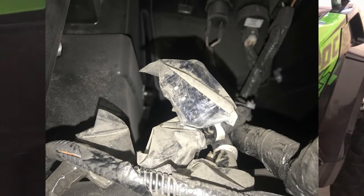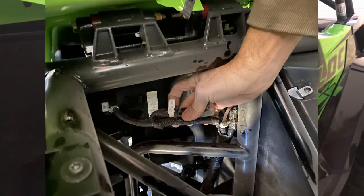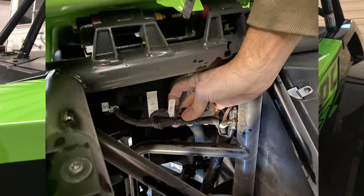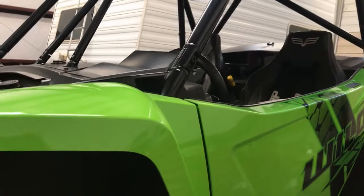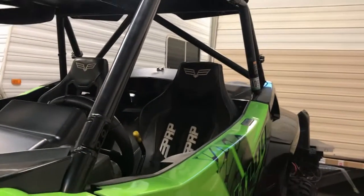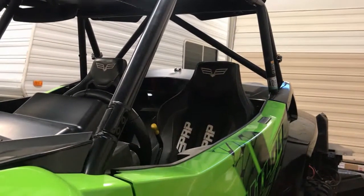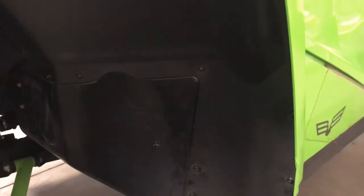So just like the B circuits, you plug the switch in, put it in the knockout right underneath the light switch on the driver's side. When you do that, there'll be power to the pin 2. When you flip the switch on, power to pin 3 feeds back to the fuse panel on the driver's side. The driver's side, there's accessory C1, and that's put a 15 amp fuse in there up to 15 amps. That feeds the SAE connector you'll also find behind this panel.